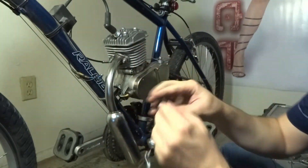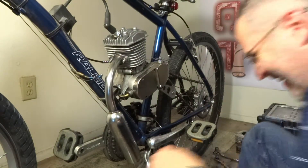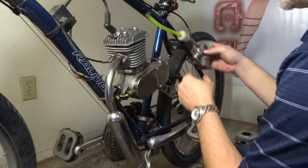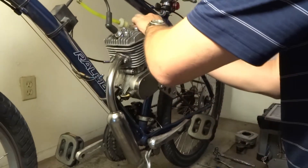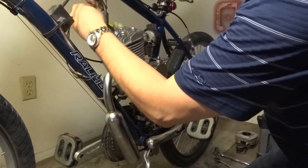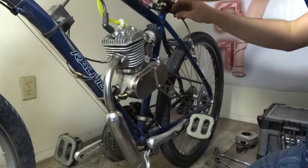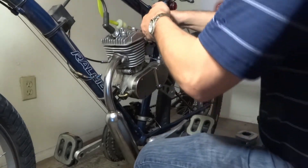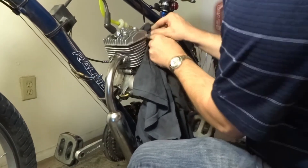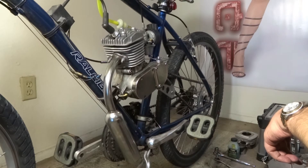Take your carburetor gasket and your intake manifold. I put on a new fuel line here because the other one was getting short. I have a very tight fit with this, so I have to finagle it. Put the hose on — got a little hose clamp on it. Finger tight is best — actually three-finger tight. Hose on, heads on tight. Thanks for watching!